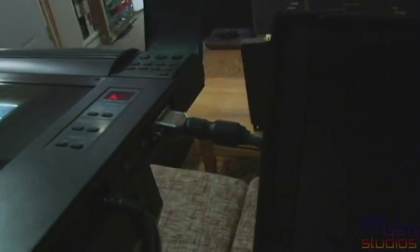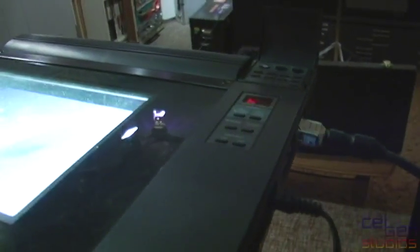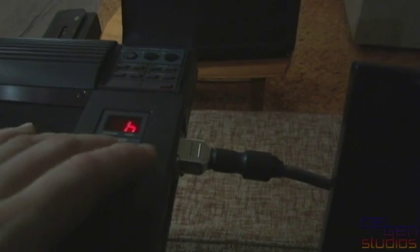We've got to use the ThinkPad because this thing works in absolutely absurdly low resolution. What drives me crazy is that — remember how I said the other adapter must have been old for the Windows 3.1 DOS era? This goes back even further, almost purely to DOS. We have our 15-pin VGA here, and right next to it we have a 9-pin video connector — so that's monochrome MDA, CGA, and EGA. And yes, as I mentioned, monochrome panel. You can see nothing on it right now. Got a couple of controls here so you can actually control your shading and dithering for red, green, and blue, and I have a couple modes I can switch between.